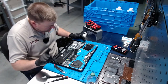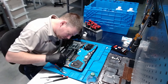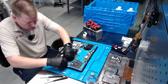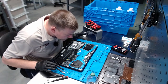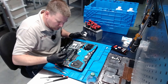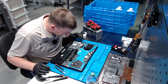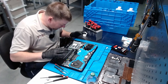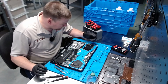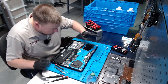Okay, laptop's back together. I did remember to take out the paper so that I can plug in my battery connector. Okay, there we go. Okay, battery's good. Just checking to make sure nothing else got knocked off. Both fans are connected. So messy. Okay, NVMe is in, screwed down, hard drive's still connected well, and all these other keyboard connectors, the touchpad and all that, all those connectors are good. And then sometimes you also have to unplug the speakers, especially if they're connected around the heatsink. I didn't disconnect any of that. Sorry, my English is a little bad. Okay, we're good. Everything looks good.